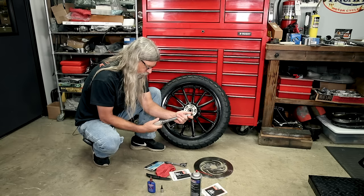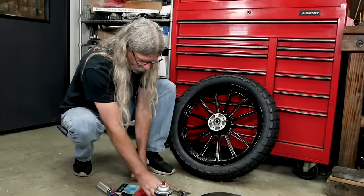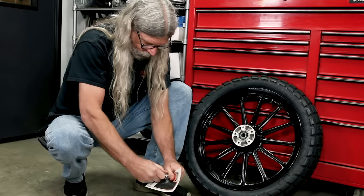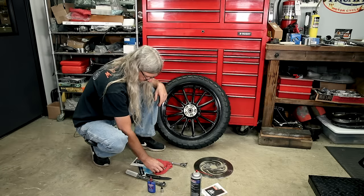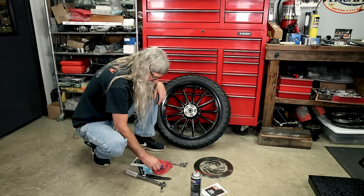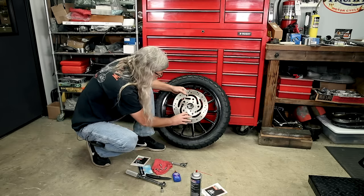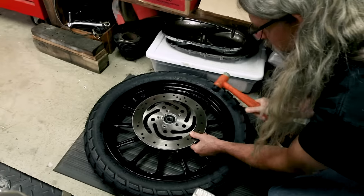XL front brakes: 16 to 24. We were at some other higher spec for those other ones, so let's go to the high end of the spec - why not, 24. We've got these awesome Colony brake disc bolt kit. These are going to be a T40 Torx head. A little Loctite and you don't have to freaking overdo it. Bada bing, that'll do it.